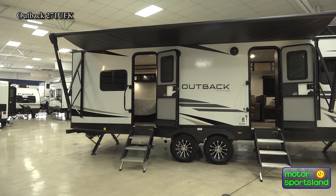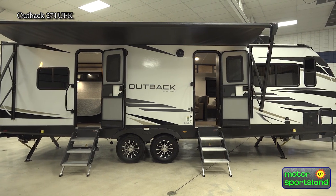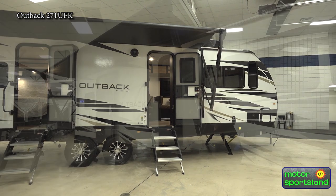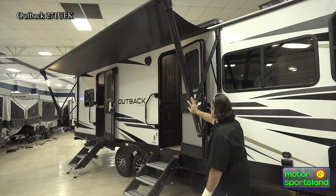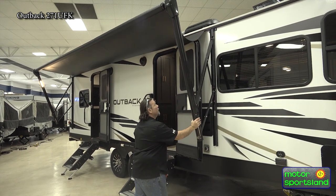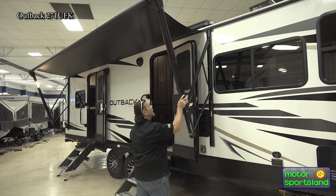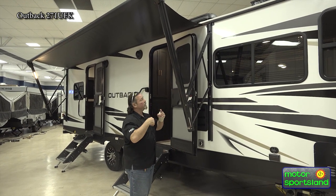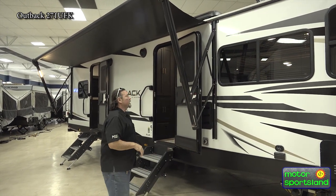We just love talking about the awnings. They're well-lit on the sides now, with LED lights shining in on the actual awning arms — so you can use them whether the awning's in or out. This has a shock-absorb system as well. If you get a little wind pushing on this as you're bringing it in, the shock pushes the awning arm out so the roller rolls in tight — you don't have your fabric all wound up around the barrel. That really makes a big difference with the electric awning.